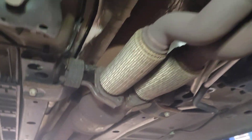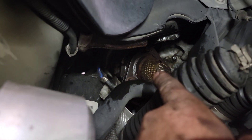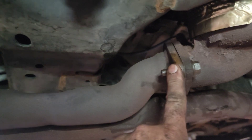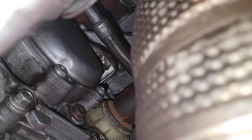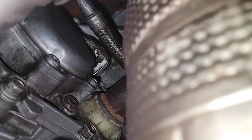I ended up cleaning up these two flanges going back together. Reused the old gasket. Cleaned up the flange at the cat and where it goes to the turbo — reused the old gasket. These bolts were in really good shape and I was able to reuse them, along with the nuts. Temperature sensor and everything put back in the side of the cat, right there underneath that little metal shield. I just pushed the shield up out of the way and then spun the wire out over.